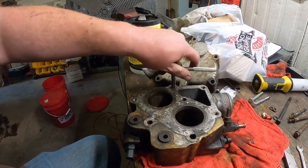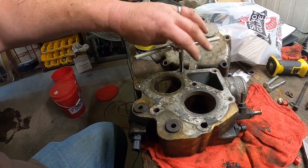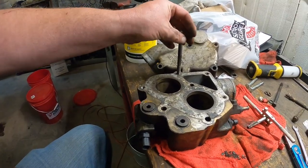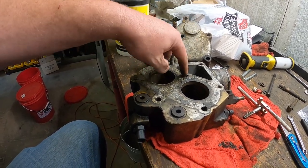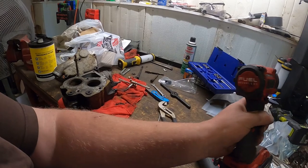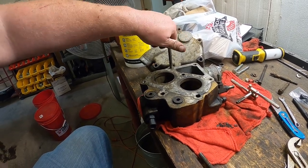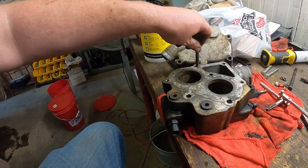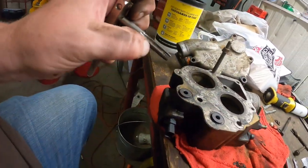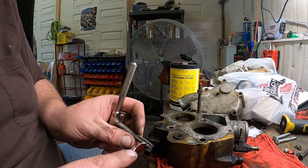When I'm done with the clean bolts, I'll take the bolt I just cleaned up and it'll screw in there real nice. When I actually took these bolts out, this center one — which holds the whole thing on — I was using my Milwaukee on number three and it was just taking forever to get out because of corrosion. I'm also going to use my tap on the three holes on the engine. You can see that dirt in there — that crud came out from cleaning them.